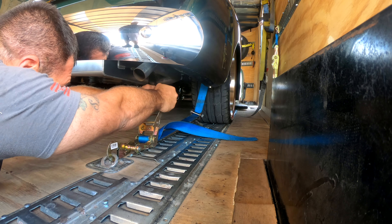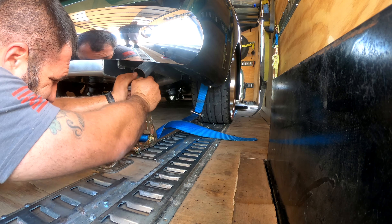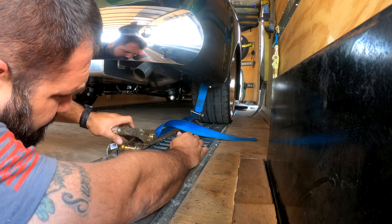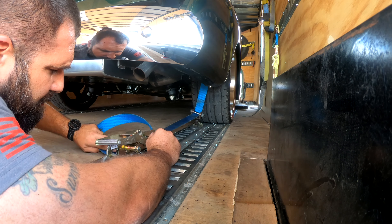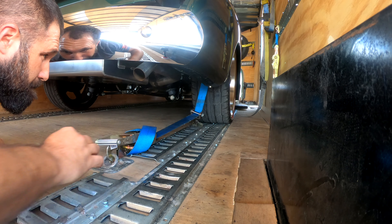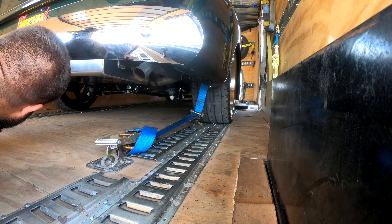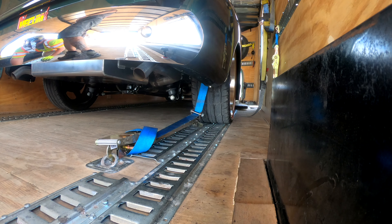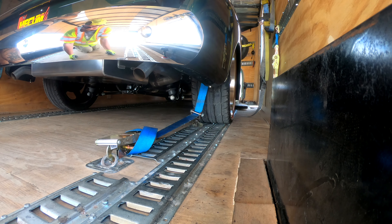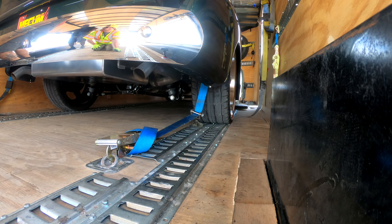You can see that vehicle's moving towards me. When you ratchet it and you're done, make sure it's readjusted and locks in there properly. You want to make sure it's locked in there, and make sure that strap is as tight as a guitar string — very, very important. Now I'm looking underneath the vehicle; I like to put a safety strap on. A lot of times I'll hook onto something underneath the vehicle if I have something there.